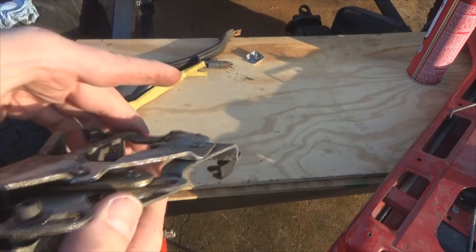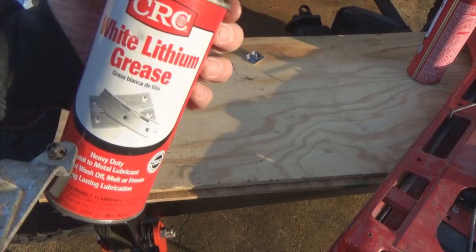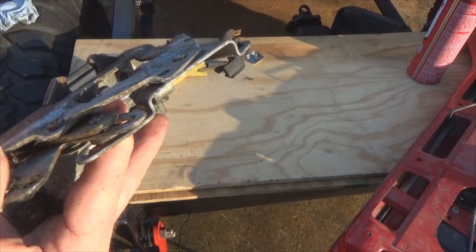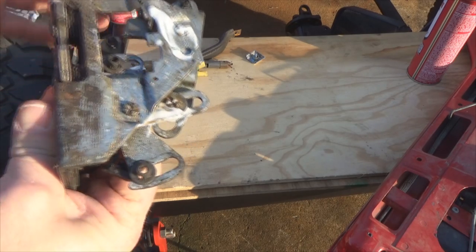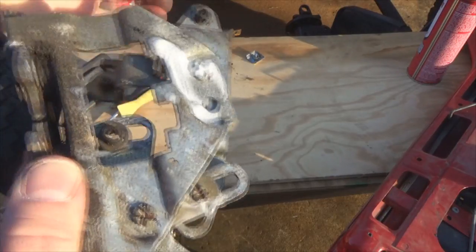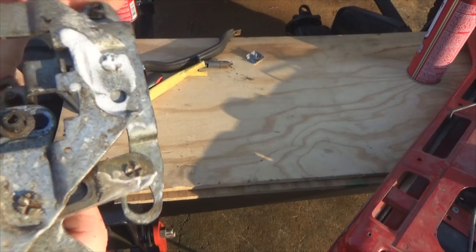I got some white lithium grease out here. This stuff lubricates very well, it's long-lasting, and water doesn't really phase it - it won't try to wash it off, so it's really good stuff. I'll spray it in between these plates right here and up inside here. That should keep it actuating just fine. Working it back and forth is going to work it in between those plates right there and be lubricated nice and proper. But honestly, if you go through this much trouble pulling it out and you actually want good solid working doors, clean it first.